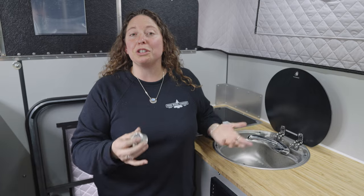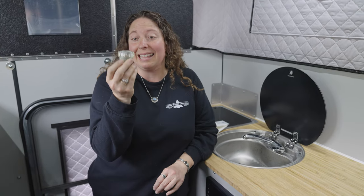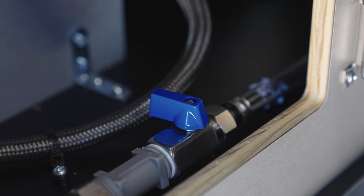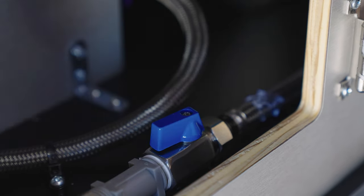It's been a long cold winter — it's springtime and we're ready to camp again. The first thing you're going to want to do to reintroduce water into your camper is to replace the filter on the water pump. Sometimes you'll want to prime it by putting a little bit of water in so the pump comes up to pressure and starts running water through the system. While we're in here, we're also going to open that bypass valve to the water heater, which will allow the water heater to fill with water. Once the system is pressurized, you'll be able to have nice hot water.